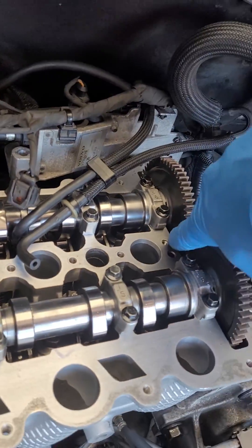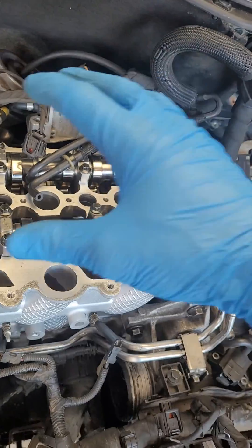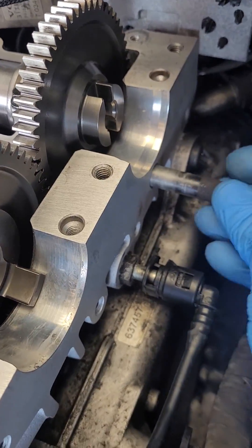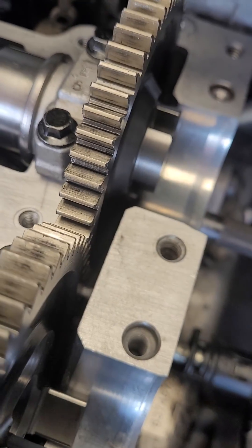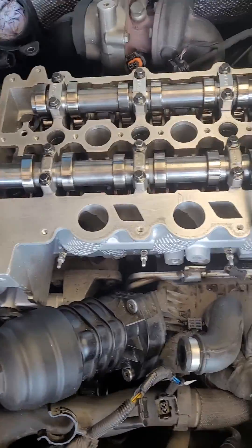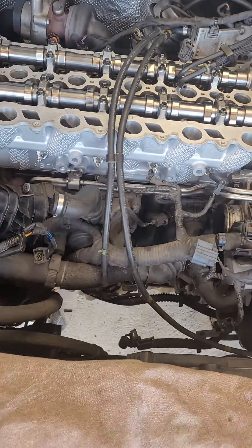With that done, I aligned the two holes on the cams — you've probably seen that if you've done some googling. I was a bit worried about tightening these down without having the overall timing right, but I've been able to tweak them all down. Then there's another pin that sits at the end here and pops in, slotting into the hole inside — there you go, that goes in there. They're locked, and I've put the pulley on temporarily just to lock them in. That is an engine mechanically locked in place.